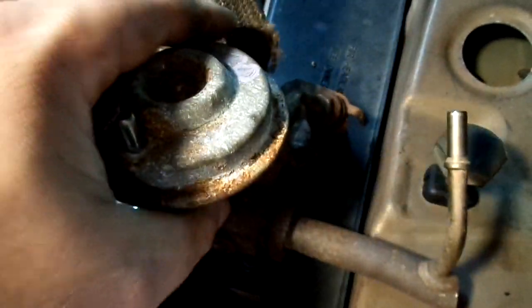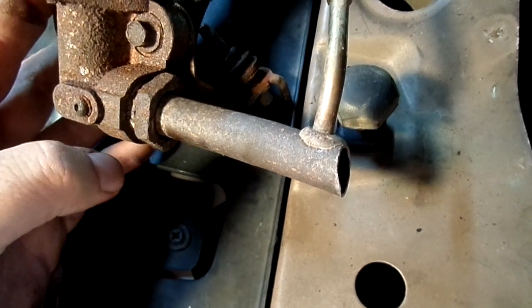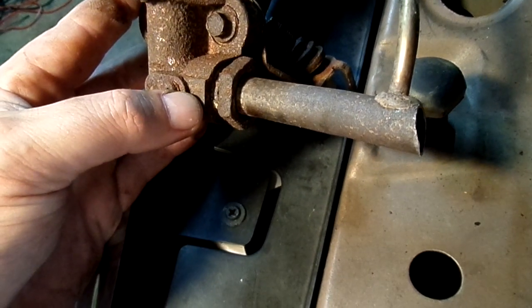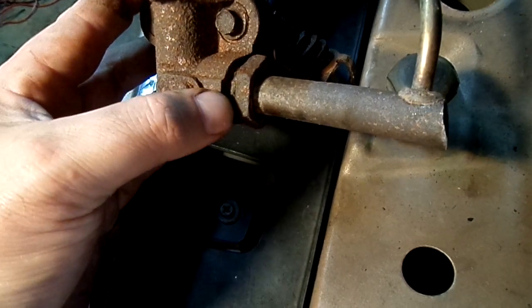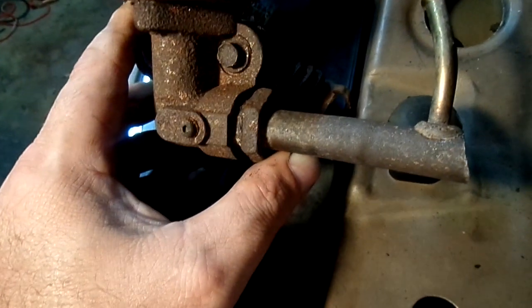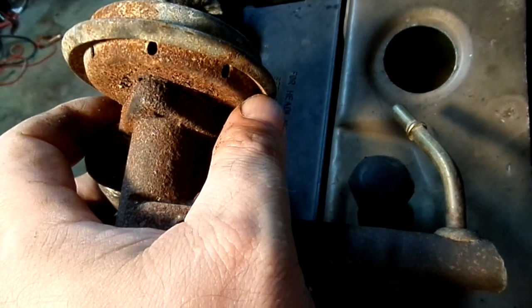As this is sitting in the vehicle, the EGR sits there and this is how it's mounted — it's mounted at one point right here. That is a 1 and 1/16th bolt, but I don't recommend using a wrench to take that off unless you had a shorty with a breaker bar. They actually sell a little set at Harbor Freight. MacTools has got one. A few other people have the 1 and 1/16th. But from the bottom, that thing is sitting right in line with the top of that little mushroom cap.